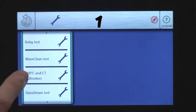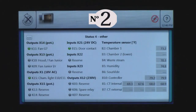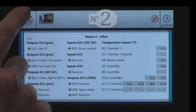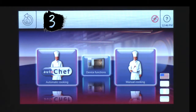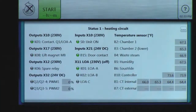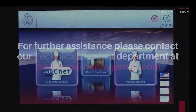And this is how you can use your relay test to help you troubleshoot a combi oven. Using the status menu along with the relay tests can enable you to find out what components are working or not working. You can get in and make voltage checks, knowing where the connectors are located from the status menu and where they're located on the relay board. Hope this makes your troubleshooting simple.